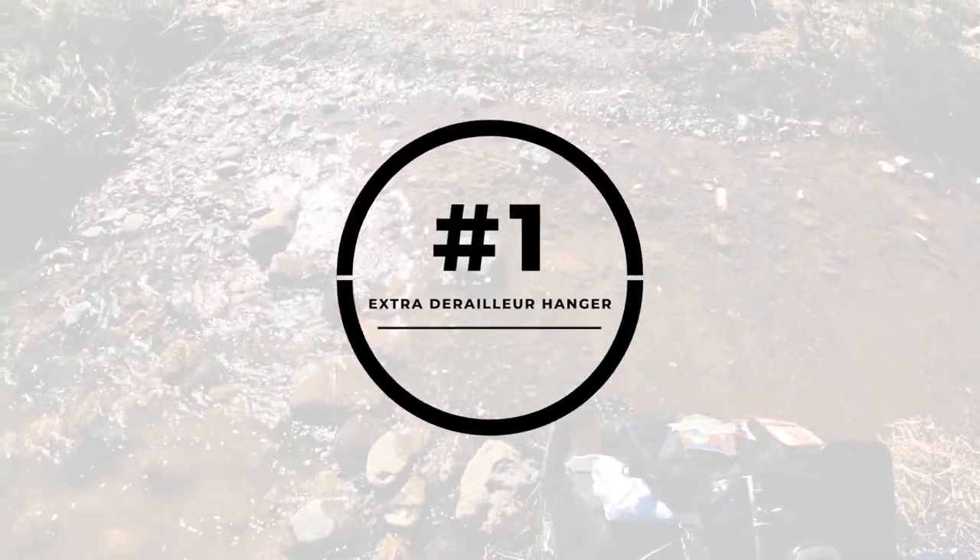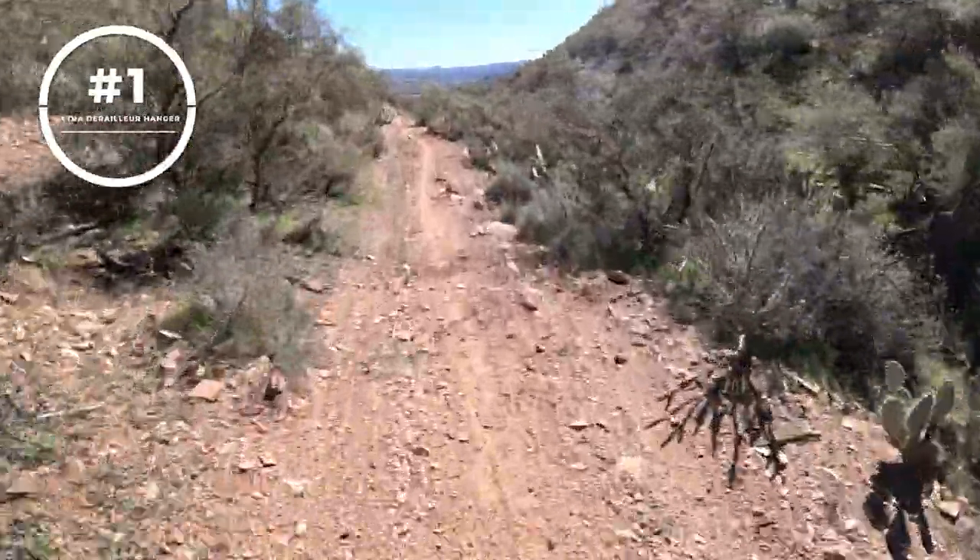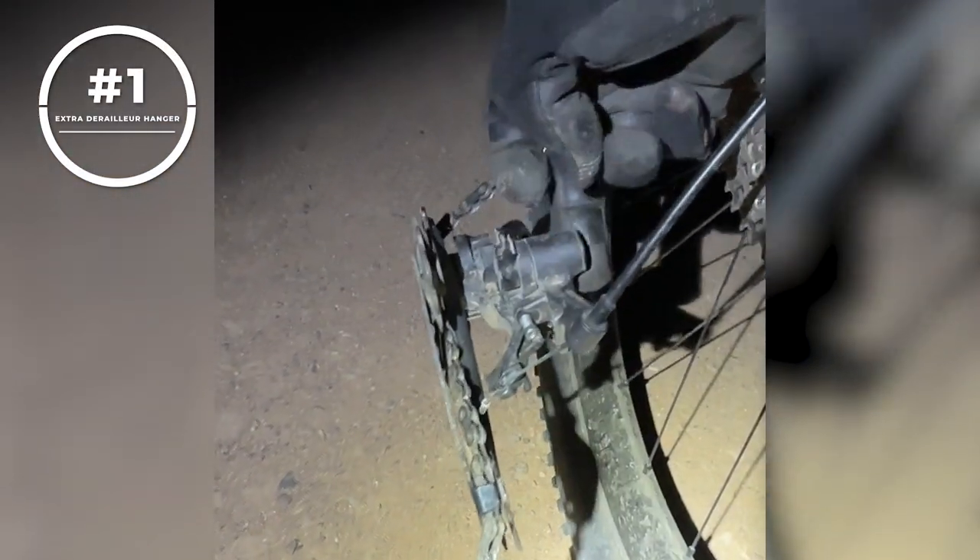And the number one bikepacking toolkit item you won't regret is an extra derailleur hanger. Single-speed bikepackers feel free to skip this and go hit that like and subscribe button. This one is real fresh for me since it just happened on my recent attempt at the Fool's Loop. I've smashed many a derailleur but this was my first broken derailleur hanger in 10 years of riding — kind of a freak accident. I rode 90 miles of fast technical single track down the Black Canyon Trail with no issues, then in a flat easy section I took a right turn, the front wheel washed out, and I went down in a pretty minor crash. I got back on my bike, pedaled, and the pedals went to the floor. I looked back to the saddest sight of my derailleur limply hanging down by the ground — the hanger had sheared off completely. I had no backup and felt like a fool. My options were to walk a few miles to a bike shop, shorten my chain and finish in a single gear, or call my wife for a bailout. I chose the latter and ordered two hangers when I got home — one replacement and one to carry in my toolkit.